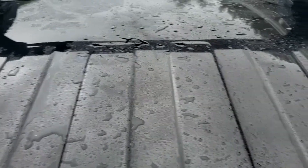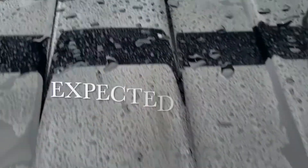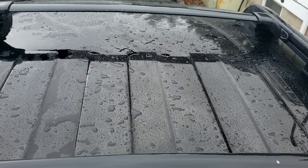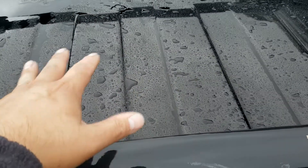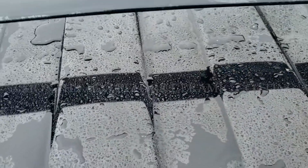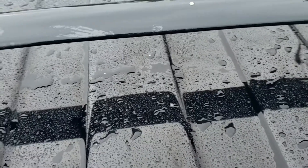This right here is what a regular paint job looks like — it's just sheeting, not great. This does have some wear from the UV rays, sun, heat — whatever you want to call it — and has lost the hydrophobic effect completely. This area has not been retreated with the reload, but the hood has. The side panels are still good, which leads me to believe that UV rays wear this product down extremely quickly.